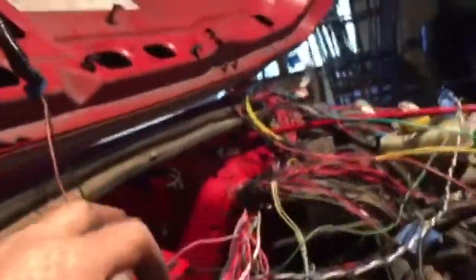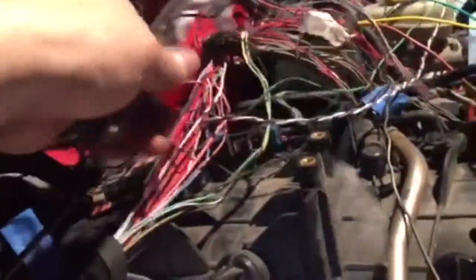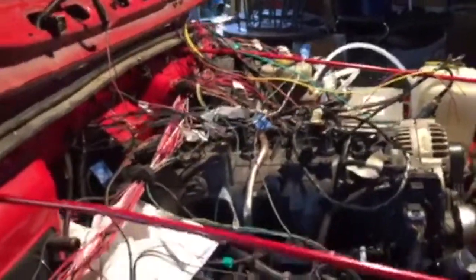Over on this side, these wires come up from the back - speedometer, fuel pump, fuel gauge, sending unit, all that stuff. So these are going to get tied into those wires through the wire bundle. Then it comes over here and back into the stock power distribution block. I've also identified all these wires here as unused circuits - one was for AC, there's a couple other ones. So these are going to go to those solid color wires, the yellow and the green, that will be hooked into relays in the stock box. It still looks kind of like a mess right now, but it is an organized mess.